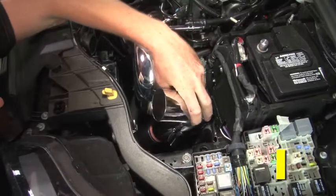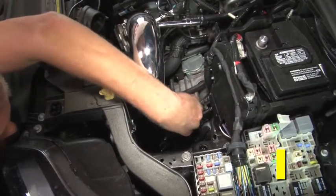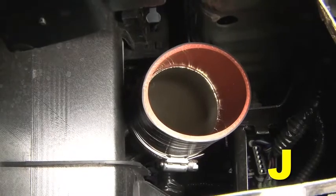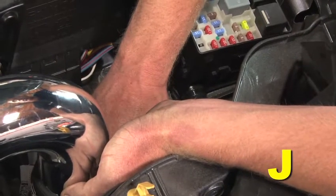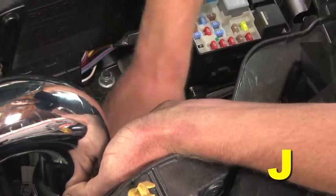Guide the middle intake tube down into the engine bay so the end with the coupler is positioned on the lower end. Mount the intake bracket onto the stud where the 13mm nut was loosened in step 3G. Hand tighten the 13mm nut to sandwich the intake tube bracket between the chassis and the 13mm nut.